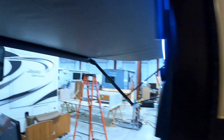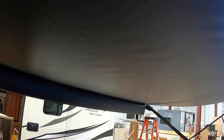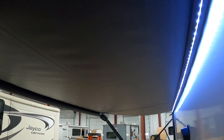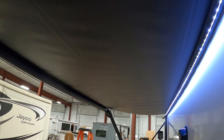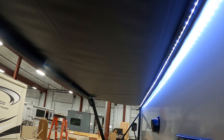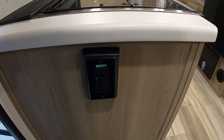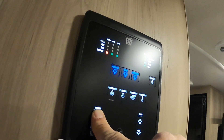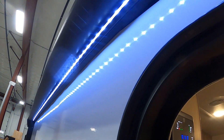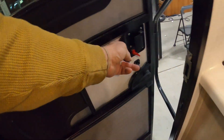Here's your awning control. On your awning, you only want to run it out until that flat bar falls down at 90 degrees. You can see that brown bar — if you hold the extend button down it will continue running out, flip up onto itself, and start running back up backwards. So keep an eye on it when you run it out and make sure you don't over-extend it. As it comes in, there's also a 110 outlet with a GFCI reset right here. These slam locks work best when gently slammed.